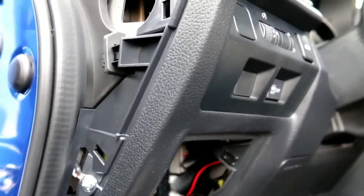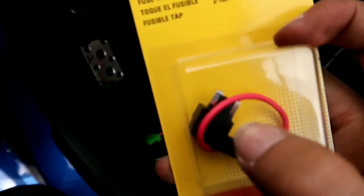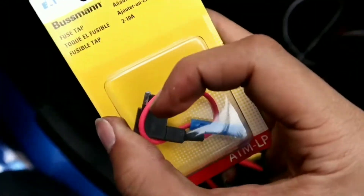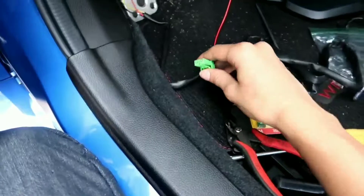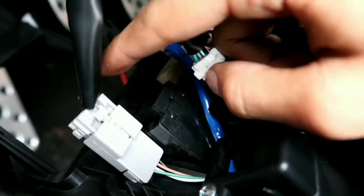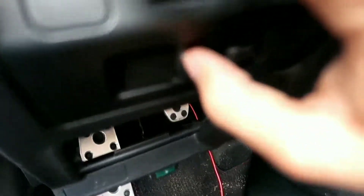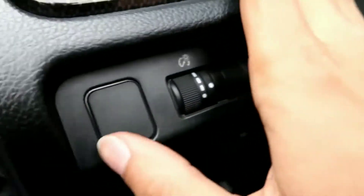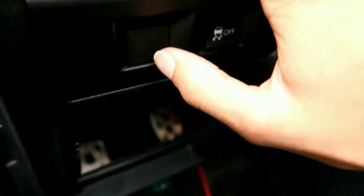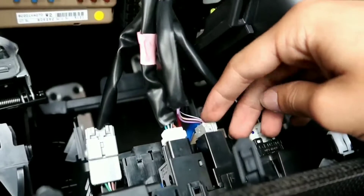Let me show you how it looks — if there are any extra screws, this is what it's gonna look like after you pull it off. It is just that one screw, then you just yank it off and it comes off pretty easy. Then you need to get yourself one of these from AutoZone — I bought the wrong one. You're gonna have to get the one that sticks out, not the low-profile one. Basically this is the switch plug. You're gonna have to use a knife and pry up these little tabs right here a little bit, then push out that little insert. The fog light switch on some kits like this one will either go here, or here, or here. On most kits I've seen on the internet, either go here — you can buy an OEM switch and just use the OEM plug which is right here, or it should be in a pink tape. I just took mine off the pink tape and connected it to the dummy pin.